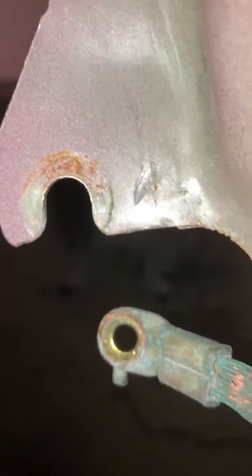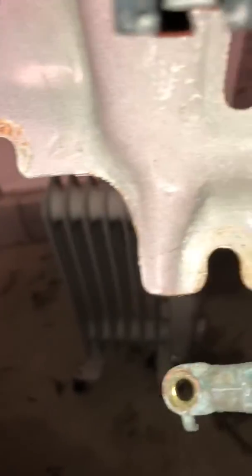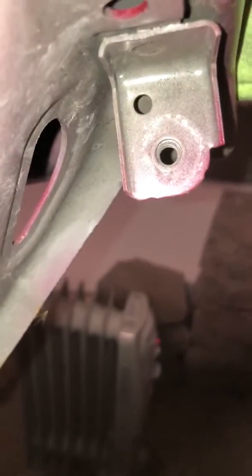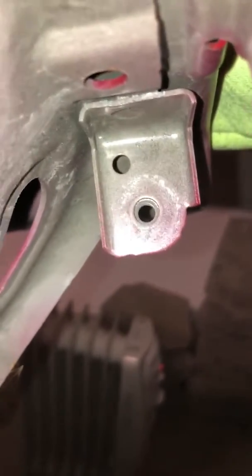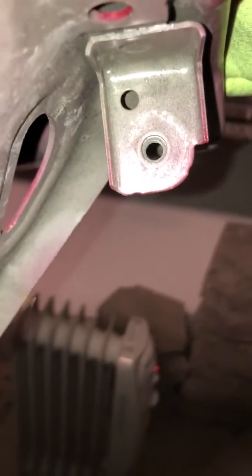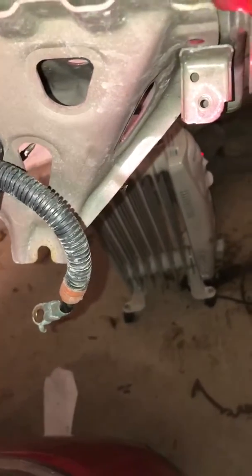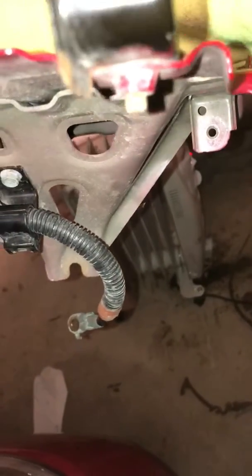And then you can see here, this is the bracket hole, and the other one on the bottom here. Oops, sorry about that. The bottom one here. Those 2, you can just loosen up. You don't have to remove the bolt, and you can slide that up after you take this bolt out. And again, this bolt hole here is the one that holds that air snorkel to the battery tray. So it's under there a little bit. I believe it was a 10mm bolt, if I'm not mistaken, that held that into place. So again, I just wanted to give you a big picture of the underside of this. 3 bolts that you have to loosen or remove, just the one that you have to remove, to be able to pull the battery tray out.